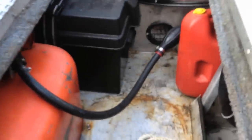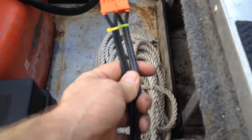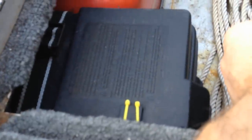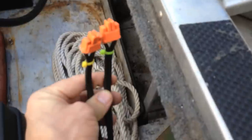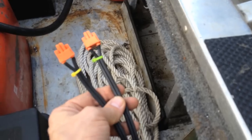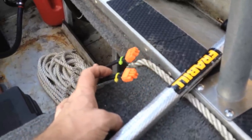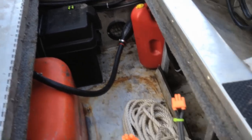So I ran wire from each battery — same gauge as on my battery charger. The green one corresponds to the green marker, the yellow one corresponds to the yellow marker. I cut the cord on my charger and installed the opposite plug on the charger, so now all I've got to do is plug in right here. It's in a corner I can reach from the garage, so I don't have to jump over the boat. Green goes to the starter battery — green means go.